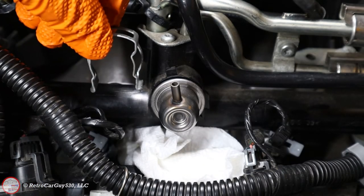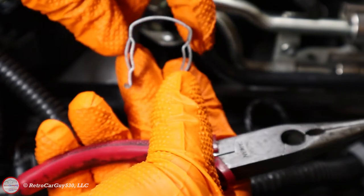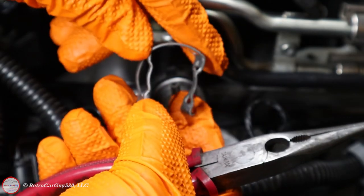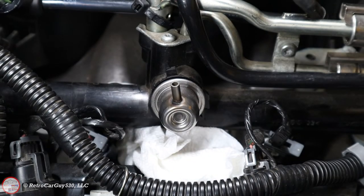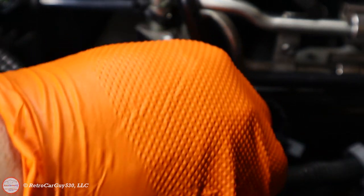The clip is off. Often the new regulator will come with a new clip if it's an ACDelco part, but aftermarket ones may not. Notice the larger portion that goes behind the fuel rail tabs is this round section — remember the orientation. The smaller portion has to go around the metal ring of the fuel pressure regulator itself. Now this is where gasoline might start flowing, so make sure you have a suitable rag to catch it and properly dispose of it afterwards. Begin to walk the regulator out gently with a little circular motion, and there's the large blue o-ring as you get to that point.